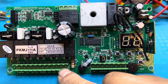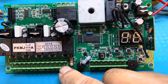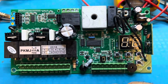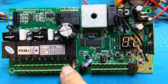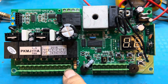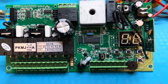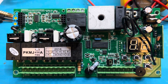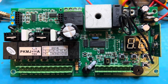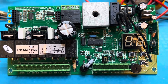The lamp is right here on this circuit board and we have a positive and negative right here — it all plugs into a connector that pops into this. The issue was intermittent: the light would go in and out, blink, or sometimes stay on. He'd tap on the control board inside the casing and it would immediately fix the problem, which tells me there's a loose connection or a cold solder joint.